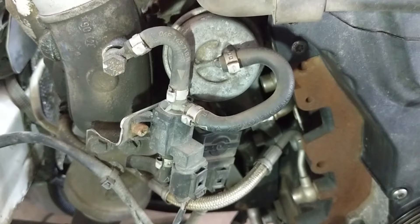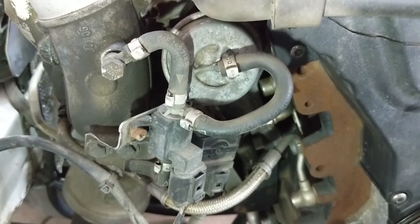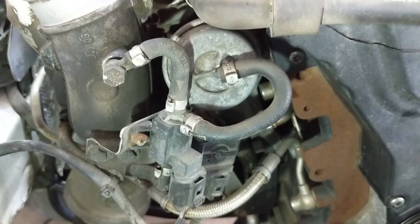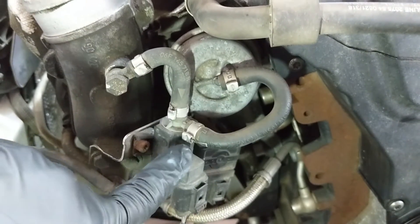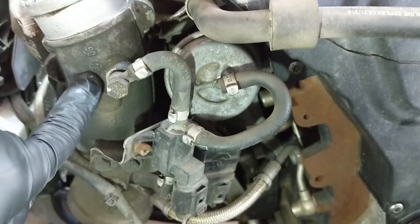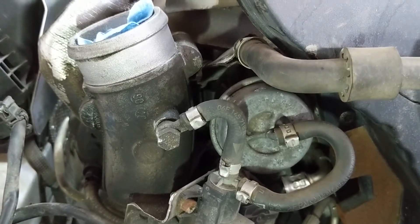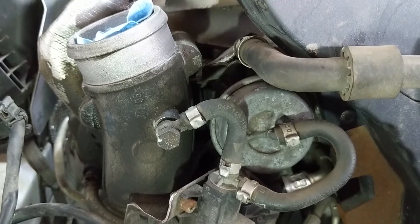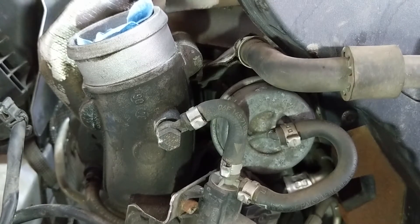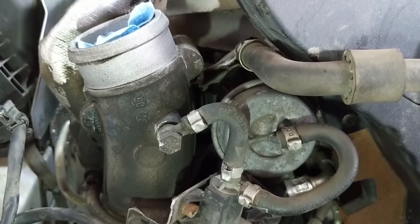In the active state of the valve — and the frequency at which it turns active is held by maps in your ECU, and keep in mind this valve turns on and off very quickly — no air goes into the wastegate actuator through this line. It's blocked, and instead a little bit of air is bled off back into the turbo intake track. The fact that the air bleedoff stays internal and does not vent into the atmosphere is important, since the engine has already calculated an amount of air that it needed to take in to maintain the air-fuel mix that it wants. So by not dispelling it into the atmosphere, those calculations stay true.